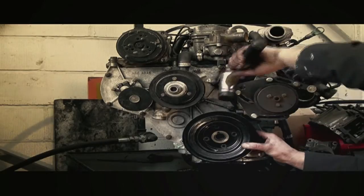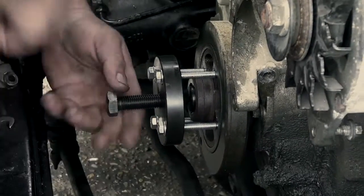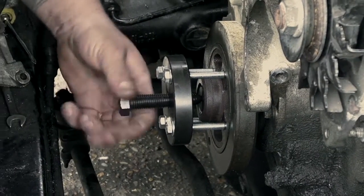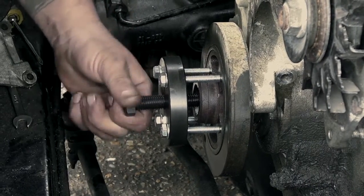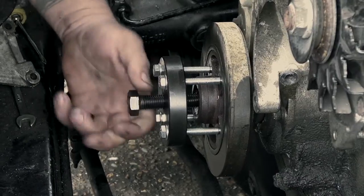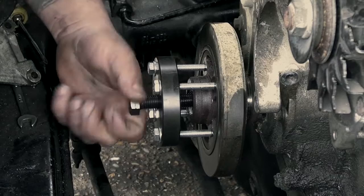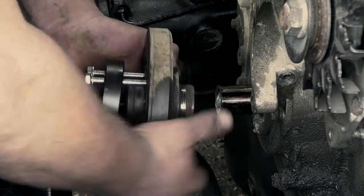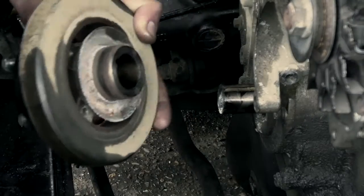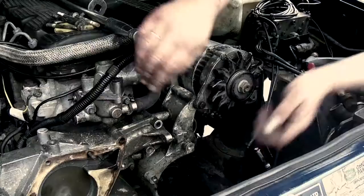Be careful when you remove this — if you tap it, it will either bend or break if you hit it with a normal steel hammer. This is the proper puller which is advised by Land Rover — this is the Land Rover tool. You can see there's no resistance pulling this off, but some of these have been threadlocked because they can rattle and come loose. It's recommended by Land Rover to threadlock it to the shaft and tighten the nut really tight.